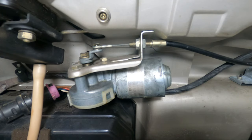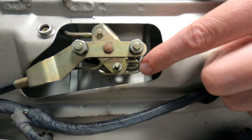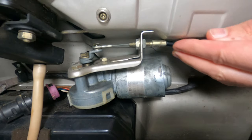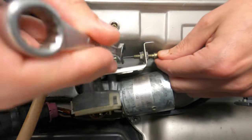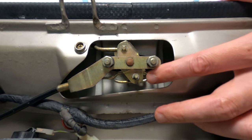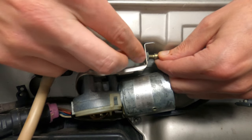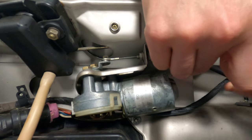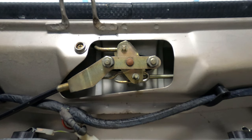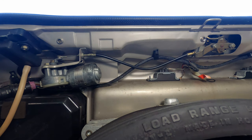Another item to inspect is the cable adjustment on the motor for the automatic release. If there is significant play between the cable and its connection point, the actuating arm will not be able to fully open the central locking mechanism. To remove the play from the cable, simply loosen the 10mm jam nut on the end of the cable sheath, pull the sheathing back, and tighten the inside jam nut to lock it back down. A properly adjusted cable will still have a small gap at the end point due to the travel length of the rotating arm. It's best to adjust the cable incrementally and test operation to ensure that it's not over-tightened. Try to adjust it so that there's a slight gap between the connecting rod pins and the center support when the rotating arm is fully actuated. With the slack removed, the motor will now be able to fully actuate the lock and release the hatch pins.